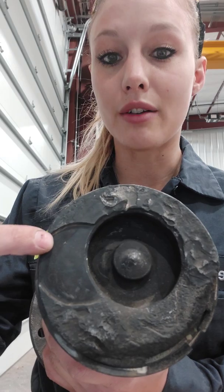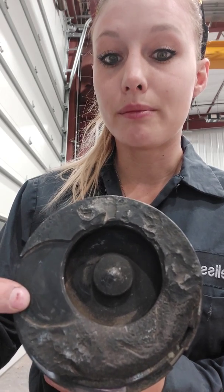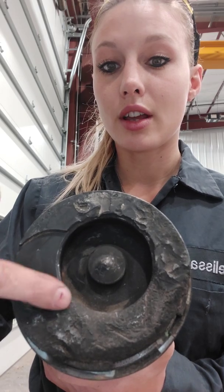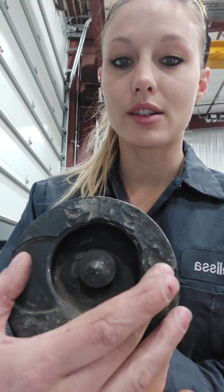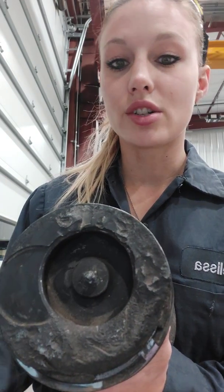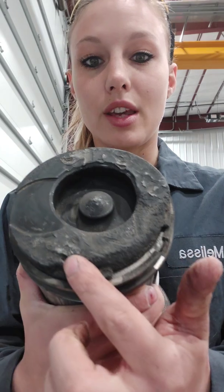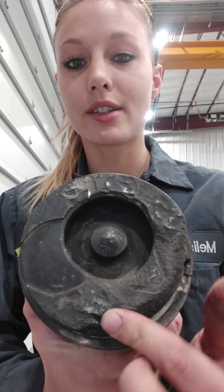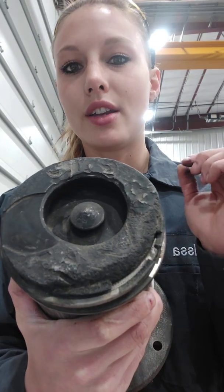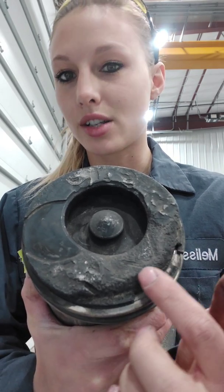This is an impression from a valve. Now some engines have machined features like this, but if you see this and it's only on one cylinder, that could mean you had kissed valves. Usually you'll see it on both sides if it's actually over-sped or kissing valves. This combustion chamber is not in good shape — as you can see, it's eaten away. That can be caused by multiple things. For those of you who like to just run a bad injector and let it misfire without fixing it — that's what it's doing to your cylinder. It can act like a water jet and erode away at your piston if it's not atomizing correctly.